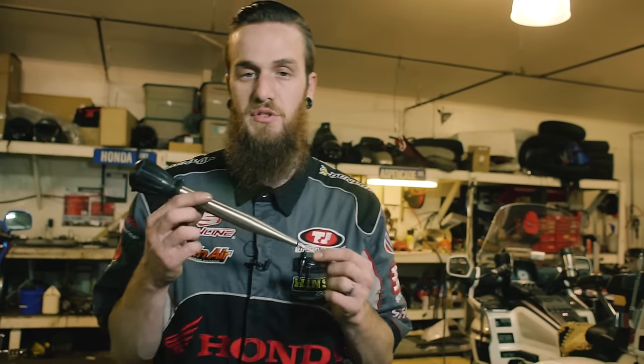What I also like to use is a good old fashioned turkey baster. This is what I use to suck the fluid out of the reservoir so that we are not pumping old fluid back into the system. You can suck it completely out with the turkey baster and then start filling it with brand new fluid, so that when you start bleeding, brand new fluid is introduced to the system.